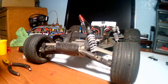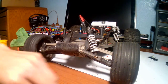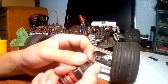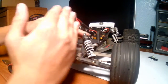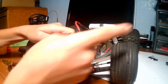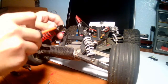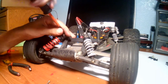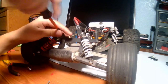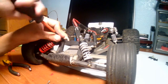Get the top bolt — it goes through the shock like this. Then get the washer and put it on next. The washer allows the shock to move from side to side, because as you can see the shock isn't staying still: once it goes down it moves one way, and once it goes up it goes the other way. Get it and screw it in. You want to tighten it but never over-tighten it, because the thread could strip and that's very bad.